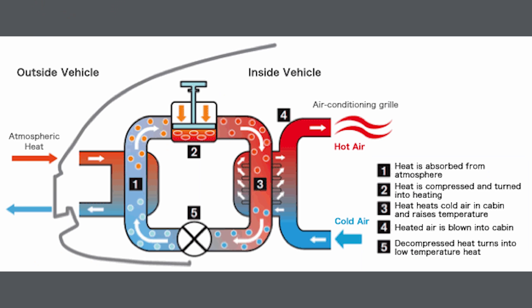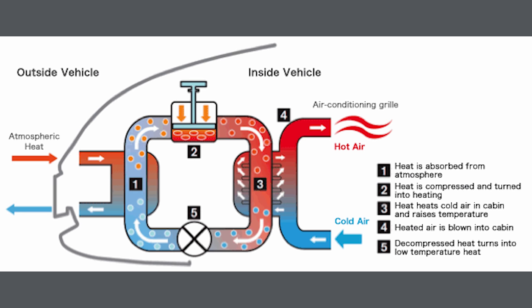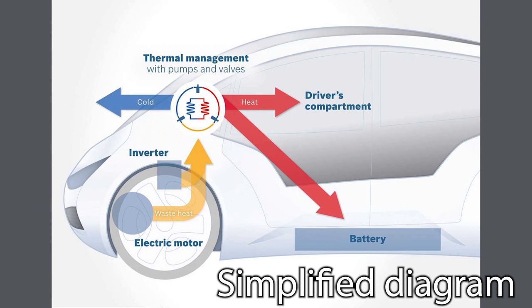The way this works is that the heat pump will actually use a refrigerant to trap the heat and move it to a different location. Instead of using electricity to generate the heat — such as a resistive heater — the heat pump uses electricity to run a compressor that moves the refrigerant around the system to move the heat, and to be able to heat air for the interior cabin or even heat up the battery. Since it's only using the electricity to run the compressor instead of an actual heater, it uses far less electricity.